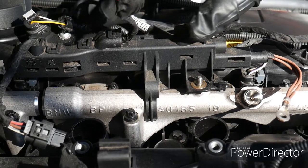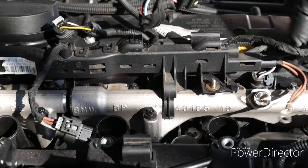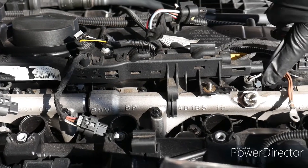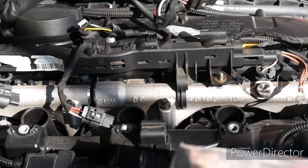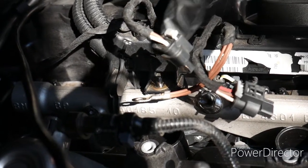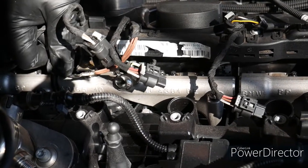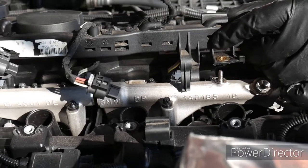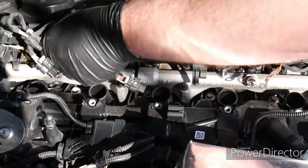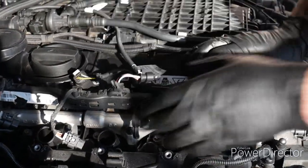So we've got this plastic piece we can remove now. There are still two connectors that are connected, but we're going to lift this up and set it aside so that we can pop these connectors out. There's one right up here and another one right back here — you can't really see it very well. There are also these two hooks here. We're just going to have to be gentle. Oh, there are six connectors — probably one for each of the fuel injectors.